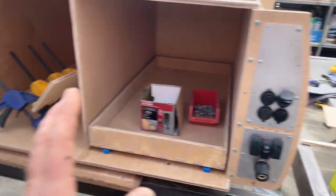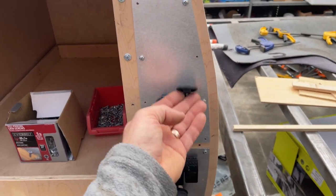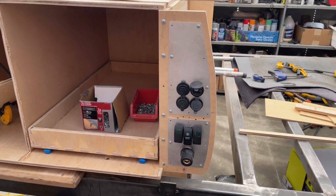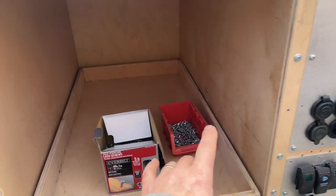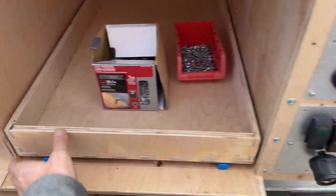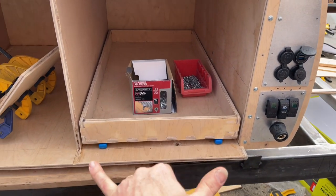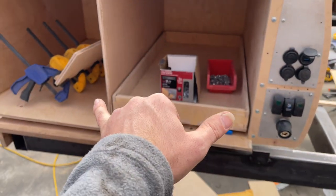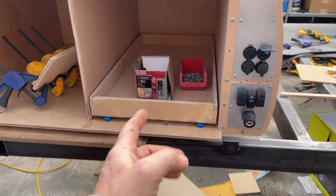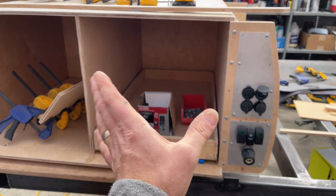I made aluminum cover plates that will hold my electrical and compressor, all the USB and 12-volt plugins for extra charging — your cameras and whatnot. A separate line will go back there for a fridge slide. This is a two-hand job, but it's a fully extendable 30-inch undermount drawer, because I want to fit the fridge in with the least amount of space lost.